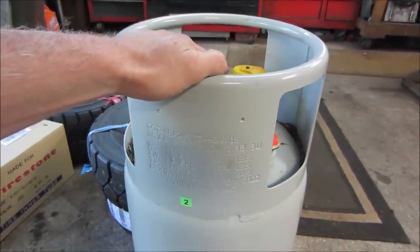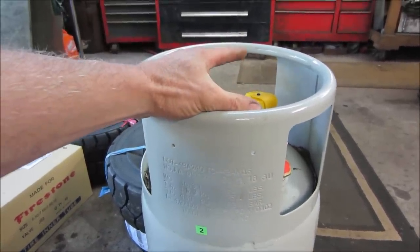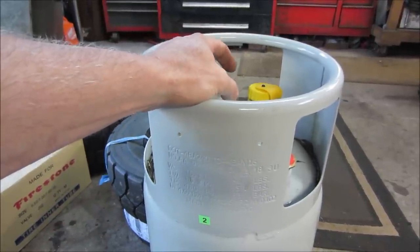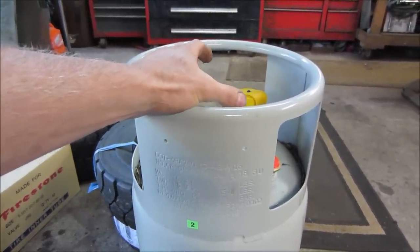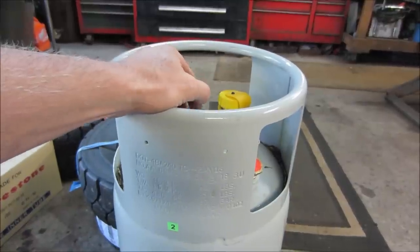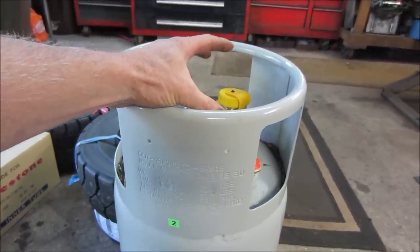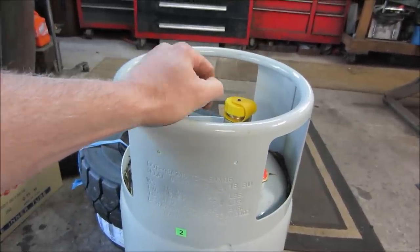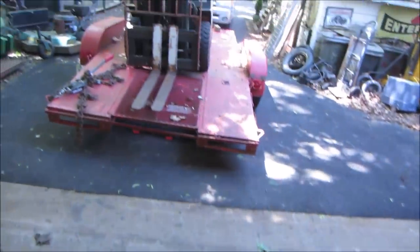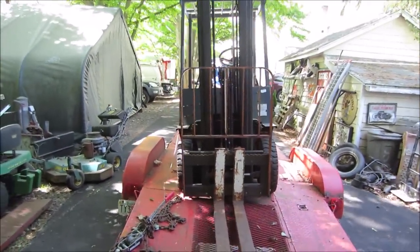Maybe we'll let it warm up and see how it does after 15-20 minutes. The way the system works, they're kind of temperamental when cold - the regulator and vaporizer are heated by the water cooling fluid, the antifreeze that goes around the engine, maintaining a warmer temperature inside those components. Today's going to be a windy day, 15-20 mile an hour wind, so hopefully it doesn't screw up the camera too bad. Maybe we'll get into doing the tires inside the garage.